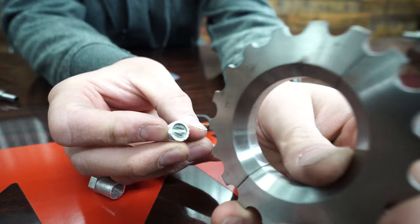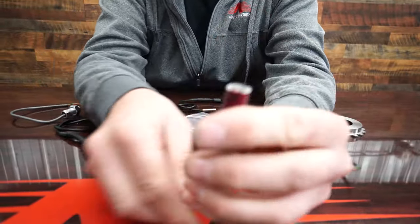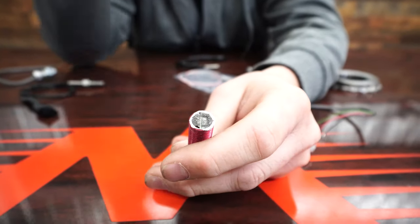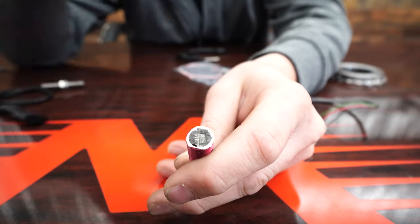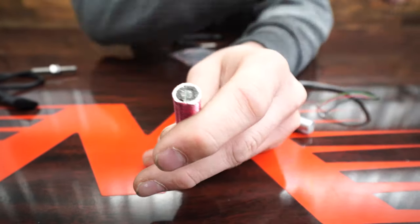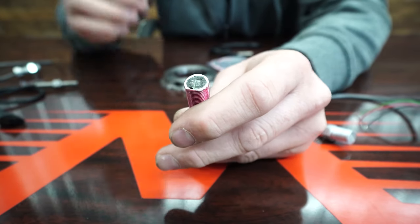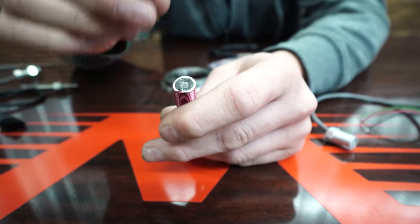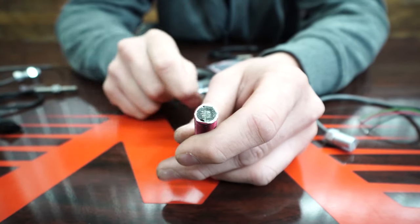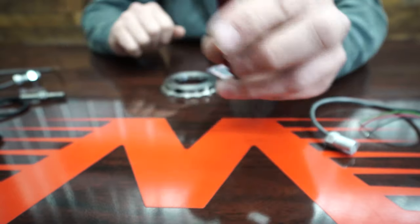If you turn it a quarter turn you're going to clean up the noise — you now have a good clear signal path going by. I went ahead and cut apart several different types of sensors, including a Cherry sensor that tons of people use. It's a really good sensor, but if you look, this one's actually offset — that little line is off to the side, not even perfectly centered. So imagine if you had your driveshaft wheel centered on that, you could completely miss it and get no signal at all. A lot of sensors are like that, and the issue is the potting — the silicone that holds everything in place. They're probably dropping that element in and when they pot it, it can misalign, get crooked, or shift to the side.